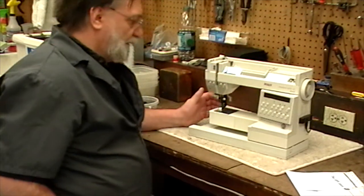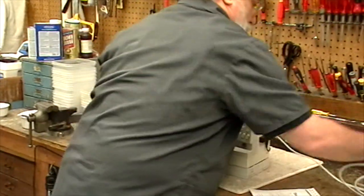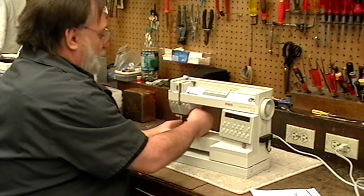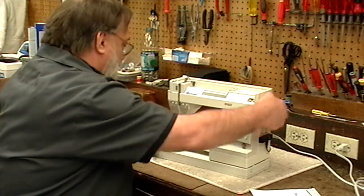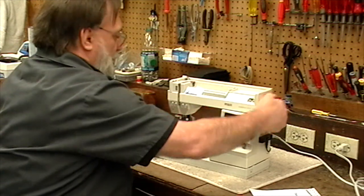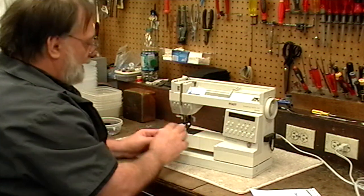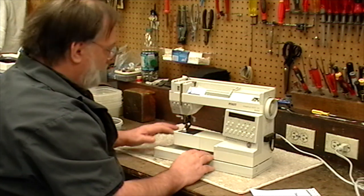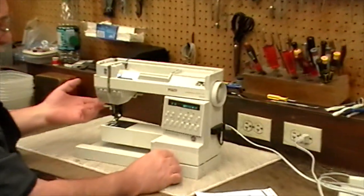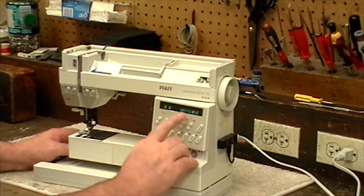This machine has batteries. I'm going to plug the machine in. First thing I'm going to do is take the needle out, remove it, and dispose of it. I turn the machine on and turn it a little bit — this machine is turning very tight, way too tight for it to be used like that. I'm going to turn it on and see what happens. We should see lights come up here, light on the end, the needle bar will move and center, the feed dog will move and center. I lift the presser foot up. I don't have a light — the bulb's probably burned out. In the display I have the word battery, batteria, pile — those are languages.